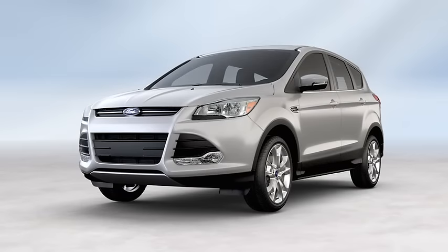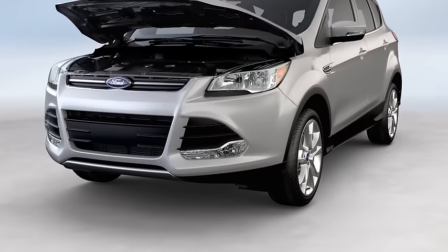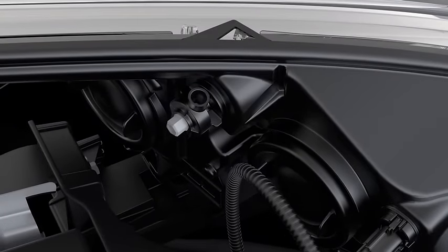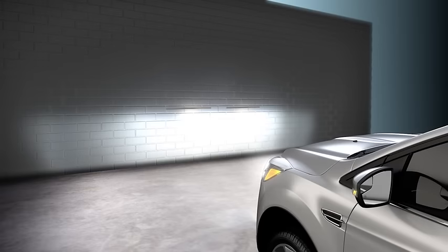Now, let's talk about what to do if your lights need to be adjusted, or if you're going to be towing something and need to move them. First, open your hood. Do you see the adjuster on your headlamps? With your screwdriver, twist each one until your beams are at the right level. And remember to leave the marks on your door or wall so that you can readjust the lights back when you need to.